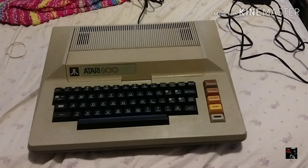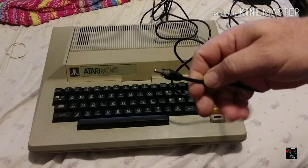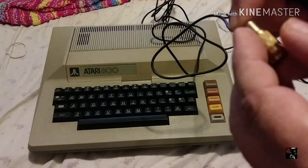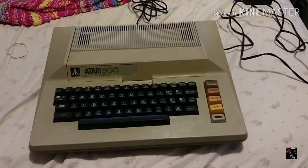It's time to get this thing hooked up. Hooking it up to the TV is no different than any other system — you've got a little cord here going into the coaxial area. You can either use one of those adapter boxes or get yourself one of these, which is a male coax to female RCA adapter. Bippity bam, you're good to go. But before we do that we've got to see if the thing even works.